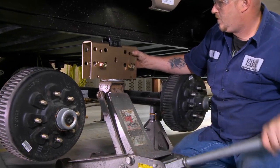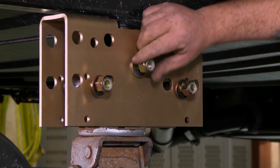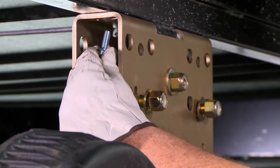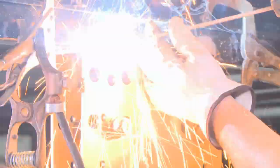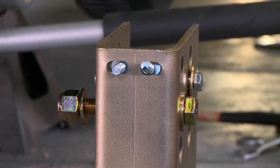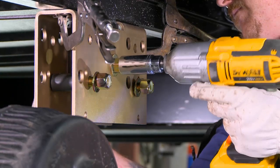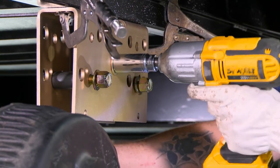This shows the installation of the Liberty Rider on the frame. The center hanger bolt must be installed to center the bracket. This system can be bolted on or welded on. Make sure the trailer is unplugged from any power or battery when welding the system on. If bolting, the Liberty Rider will be put up over the hangers and bolts marked, then removed and pilot holes drilled. Make sure a drill stop is used. The bolts are thread cutting and should be tightened to keep the bracket from twisting.